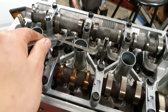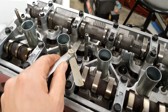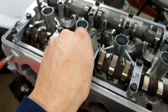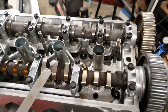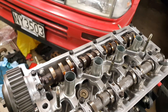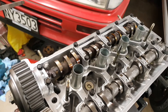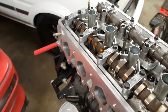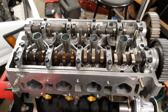You do like two cylinders at a time - 0.40 again, same with that one, just going in tight. Pretty simple - I'll do the same for the intake with slightly different measurements for clearance on that side. Hopefully it's all good because this is as it was from factory - I pulled all these out and put them in individual compartments in my plastic box so they wouldn't get mixed up. Hopefully the factory spec is good and I can just bolt these in for good.